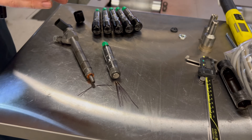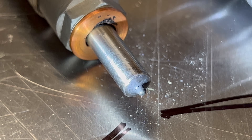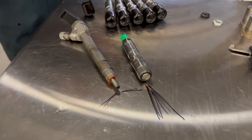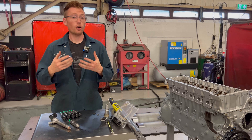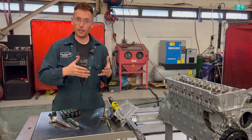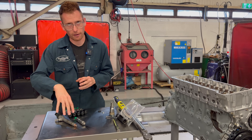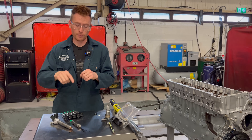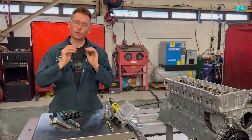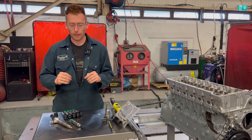If we look at this direct injection injector, you can see those tiny tiny little holes. Those holes are what delivers the diesel. That leads to the question everybody asks: do I need upgraded injectors for higher performance? This is not like the common rail — we aren't restricted to a bunch of tiny little holes to get diesel in. With the pintle style we are able to dump as much fuel as we want within reason inside the cylinder without any restriction. That's quite a big difference.